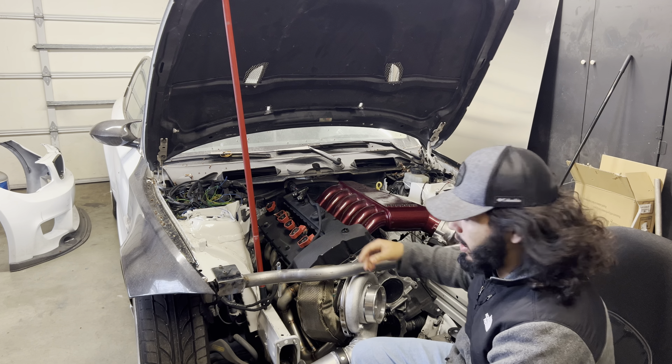What I'm going to do is transfer that position over onto the crash bar, which is somewhere around here. Then I'll go ahead and drill a hole so I can run this bullet through, put a mark on there, tape the area, mark out the shape of the hood pin once it goes through, and then I can start cutting it up.